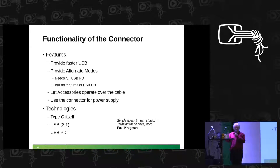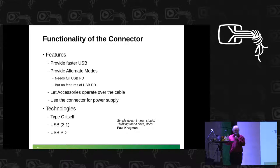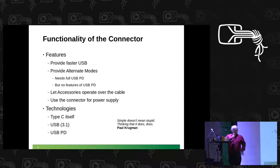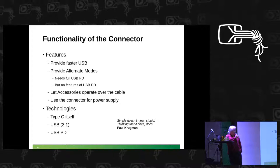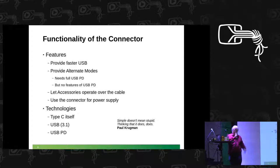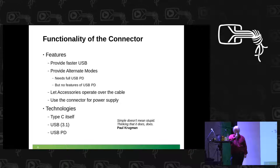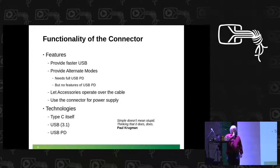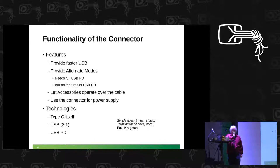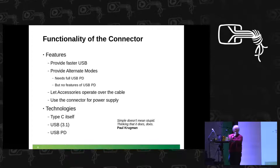You can put a lot of power over it — in fact, 100 watts at the maximum. So it is also designed to unify and get rid of power connectors. It uses three main technologies for that: the Type-C connector itself, USB 3.1 which is interwoven in the specification in a rather complicated manner, and USB power delivery — which is not strictly speaking limited to the Type-C connector, but in practice is, and is indispensable for the operation of the connector in alternate modes. For USB, it works without.